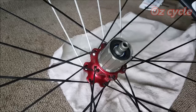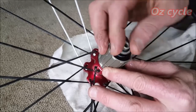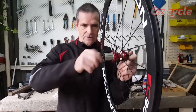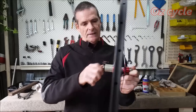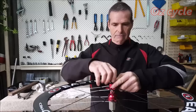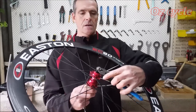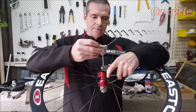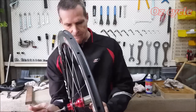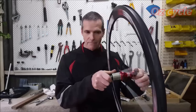All done. While we're here, put the little end cone on — it's really just a lock nut. Use the cone spanner like we did at the beginning and the 5 mil allen key. Tighten that side up and make sure it's just right. That should be it — all done, smooth, nice clutch. Beautiful.